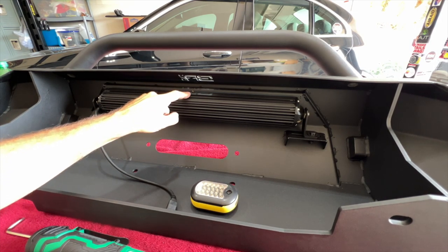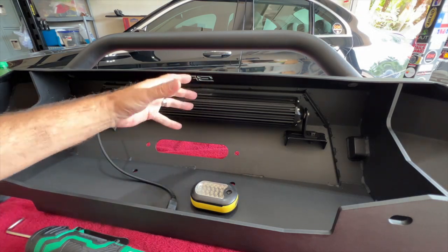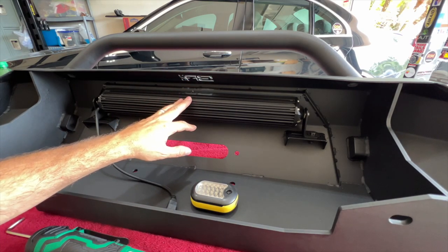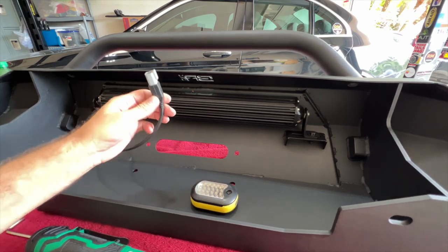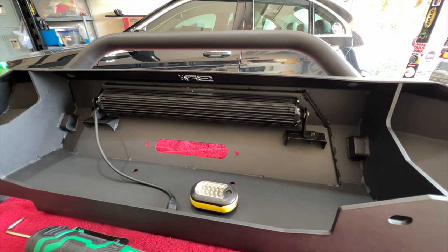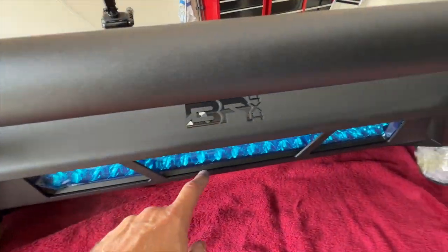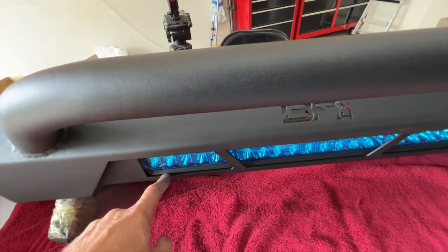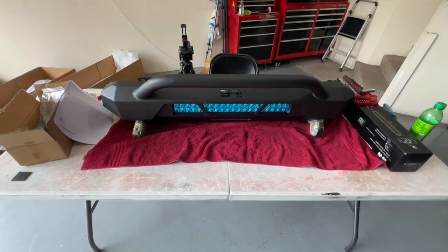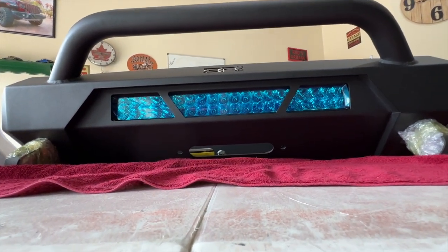Got it on — I had to finagle the brackets a little bit. A little tip: I marked the center point as a reference, because everything wants to move every which way. It's not perfectly spot-on but it's pretty darn close. Looking at it from the front, you can see it's pretty even — my goal was to get the line across the bottom even where the light meets up, and it's almost spot on. That's how it will look on the front of the truck, so I'm happy with it. Note: the blue cover will come off.